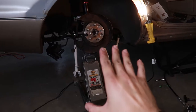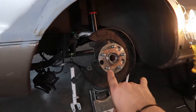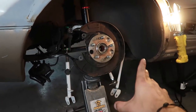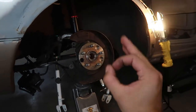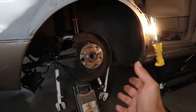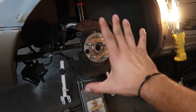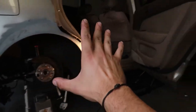The jack is now holding everything together. With nothing bolted on the bottom, we'll have free play from the upper control arm to fit the axle in. Once the axle is in and everything checks out, we can bolt up the bottom and see how everything looks once tightened. As you guys can see, this is making some awesome improvements on the passenger side. Everything looks so good. We're also going to start working with the extended studs to get those in so the wheel can sit properly on the rotor.